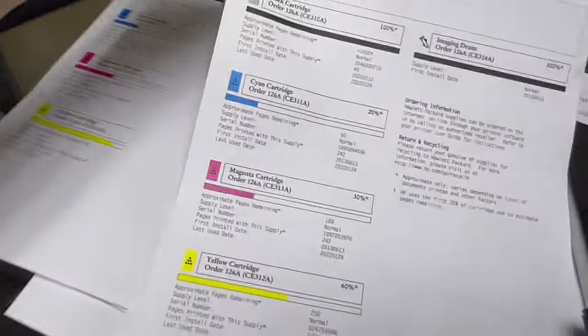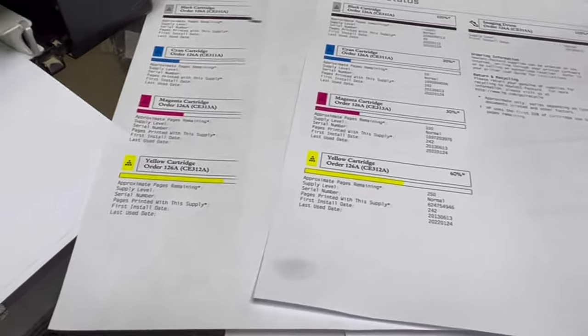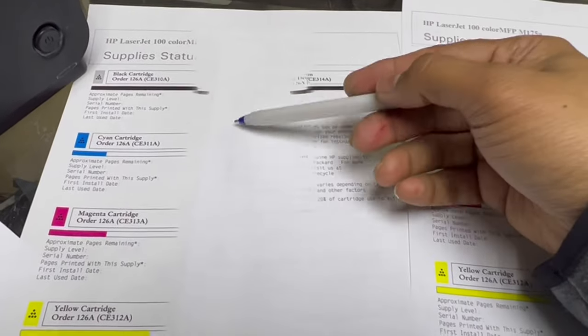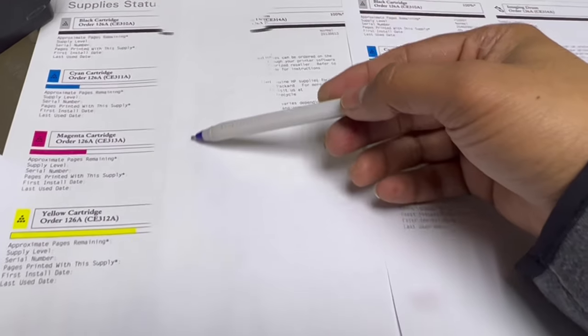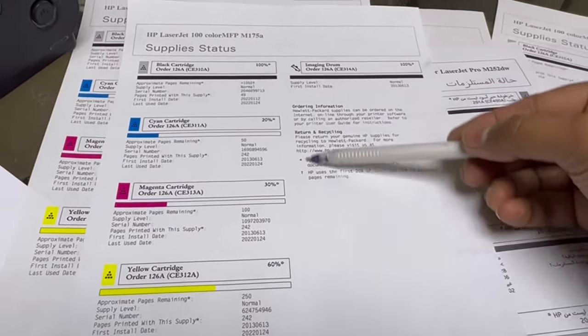As you can see, it's fine now. There is no issue at all from the center. Look, before, it was printing, missing the colors from the center. There was a white gap over here. And after lifting it a little bit up, there is no issue at all. Okay.